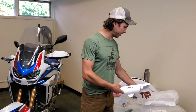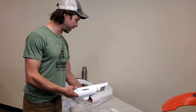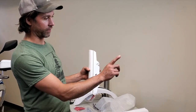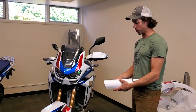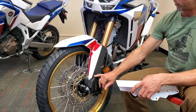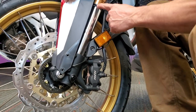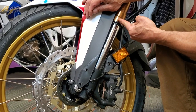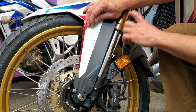Onto the rest of the kit: the fork guards. We went ahead and pulled them out because they're quite beautiful and wanted to show them off. Specifically, we chose to do them out of aluminum. Unlike some of the other kits where you end up having to source your own dirt bike fork guard — it's plastic and then you have to trim it around to make it fit from the dirt bike onto the adventure touring bike. When we take off our lower fender, we lose our fork guard, which is protecting the polished fork stanchion. The only way this system works is if that beautifully polished surface is perfect so that it does not nick your fork seals. You've got a dust guard and then a fork seal in there — if you get any dent or nick in there, you're going to tear your fork seal and then you have leaky fork seals.